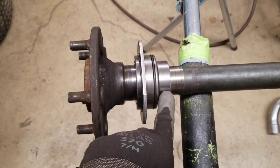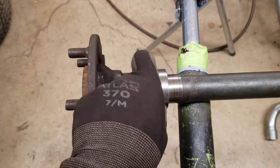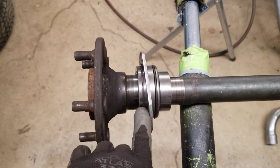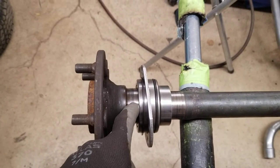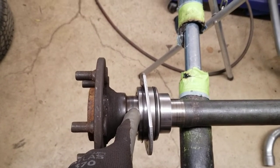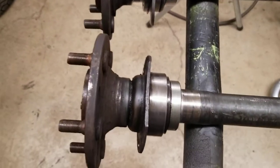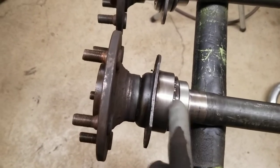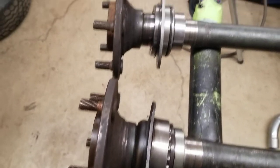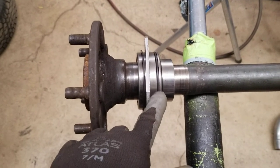You can see this one has an o-ring on it — there's your keeper. So when you press these on, you got your flange already on there. It's got this little snap ring on the back. Then your bearing actually has a seal on the inside that kind of goes up on the axle shaft itself, and you just press that into location. Here's your old school ones — you got your flange, a bearing race, the bearing underneath, and then your keeper. So this is a sealed bearing, new school setup, which is really cool.